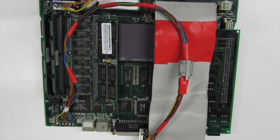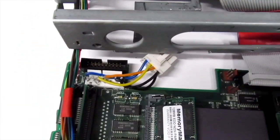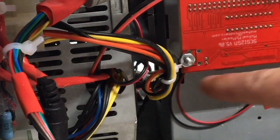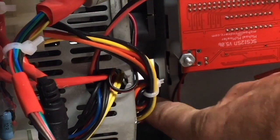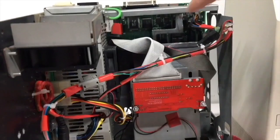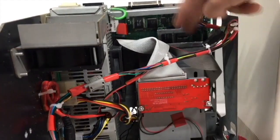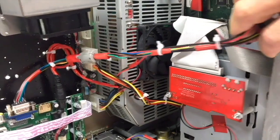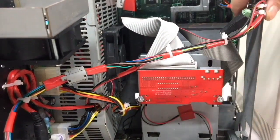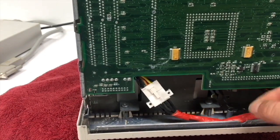Here you can see the modification I made to the power connector. You slide the board in and plug it into the power cable once it's inserted forward. I route the power cable down through a slot right next to the floppy drive — that eliminated running the power cable over the top of the board and across to the analog board. For the floppy cable, I routed it through the PDS slot, and you have access forward. It's pretty easy to get on and off.